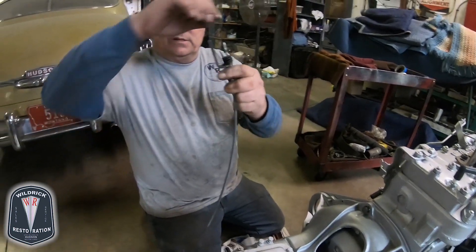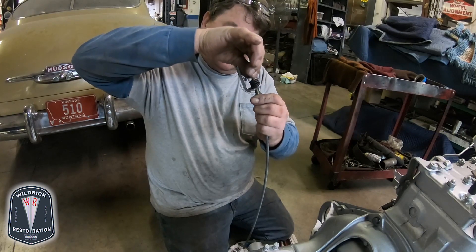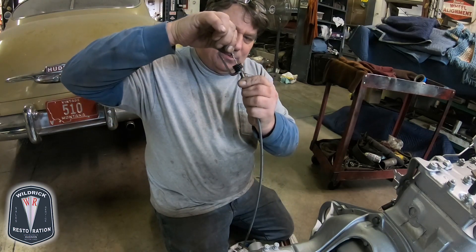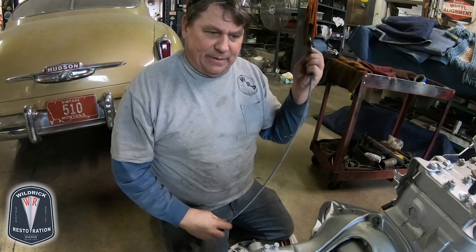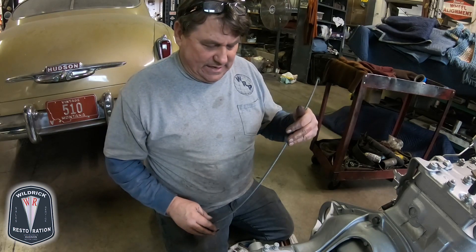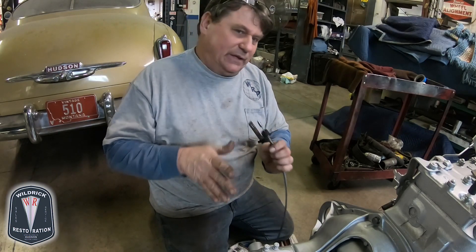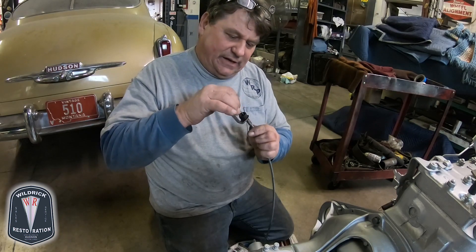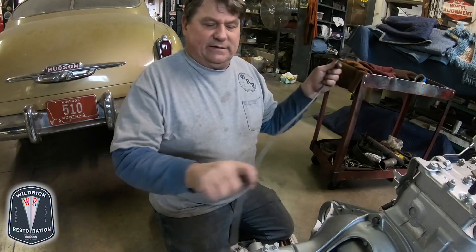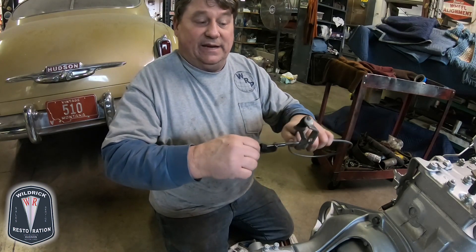We verified this cable works and is free — you have to verify it's a must. You have to verify this cable operates this smooth. It's not uncommon to find this metal casing worn, chafed, or sometimes even split. If it is, it affects the shift ability completely. This cable is what they call the gate cable — it actually operates the gate. This one obviously operates very free. Even in its bent position, it should work pretty free, and it does.